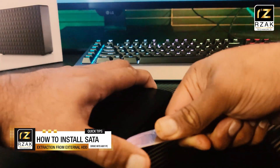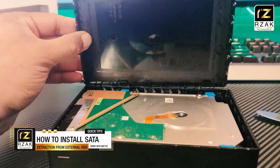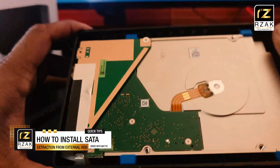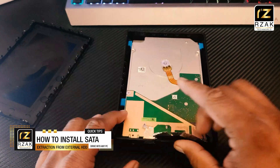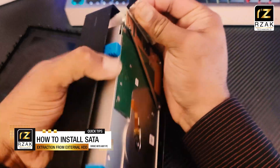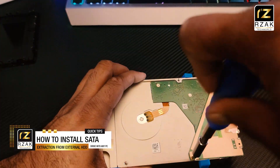Next, open the top cover and you will see the internal drive tightly packed in the disk enclosure, with the adapter circuit board, which you need to take out. Don't throw it away as you can use it later if you need to. Carefully extract the hard drive from the enclosure. In my case, I pulled the hard drive by using an aluminum safety tape wrapped around the circuit and drive. You could use a screwdriver or some other tool to pull it upwards.